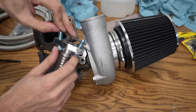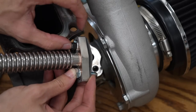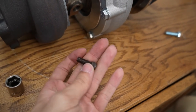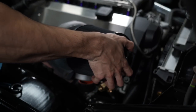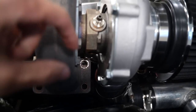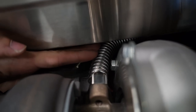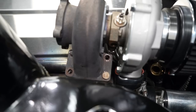I got the drain here. I'm going to put the gasket on and bolt it down — mix matching the bolts, hopefully enough threads to compress the lock washer. They did send it with hex nuts but I don't see myself fitting a socket in there, so I'm going to use the shorter Allen head bolts instead. Holy moly, that thing flexes a lot — and it's good. The reason I can't clock the turbo up more is that the moment I turn it more vertical, I can't get the nut onto the stud to tighten the turbo to the manifold. So that's as good as it's going to get. The flexible drain looks so good coming down right there.